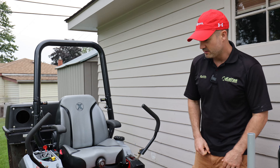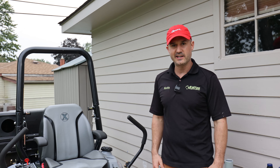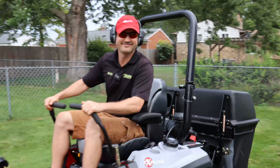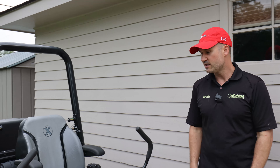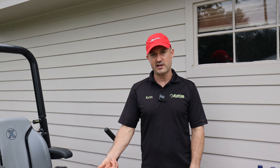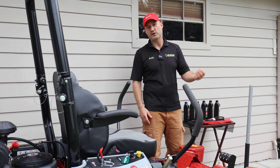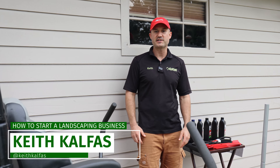So what do you look for when you do maintenance? Wash the whole thing and clean it — I just washed it, as you could see it was filthy, then I cut the grass and now it's dirty again. It's a lawnmower, but nonetheless I need to change the oil, scrape the deck, change the blades, check the hydraulic fluid. Let's get to it.